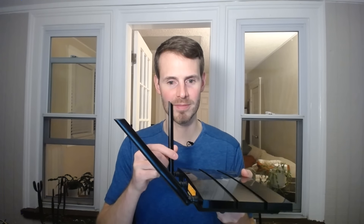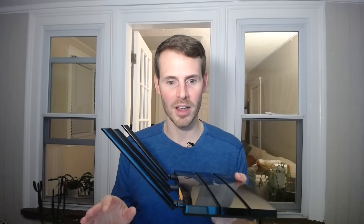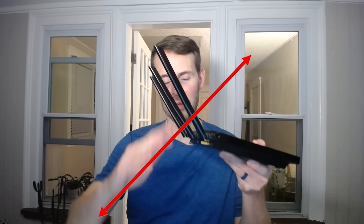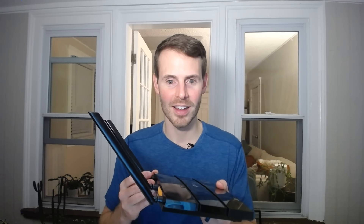So I got a little smarter about my router's antennas and started to align them a bit differently. I would make sure the face of the antenna was pointing toward the area of the basement where my wife and I were working out and watching YouTube videos — basically orienting the antenna so the signal would be broadcast in the direction of the basement. Surprisingly, by changing the orientation of my router's antenna, I immediately saw an improved wireless signal in the basement and we had no problem loading our YouTube videos and working out. This is just one example.